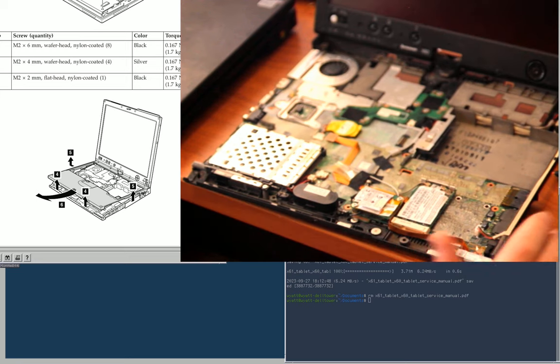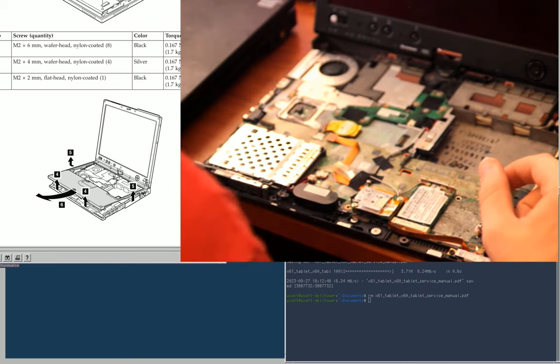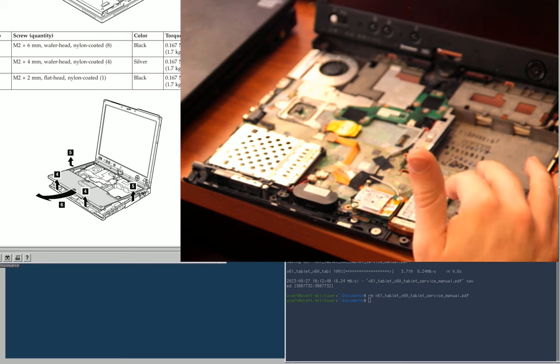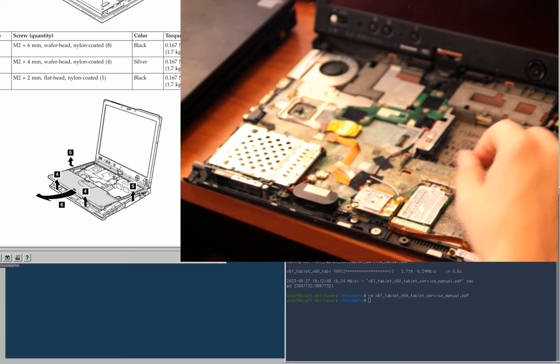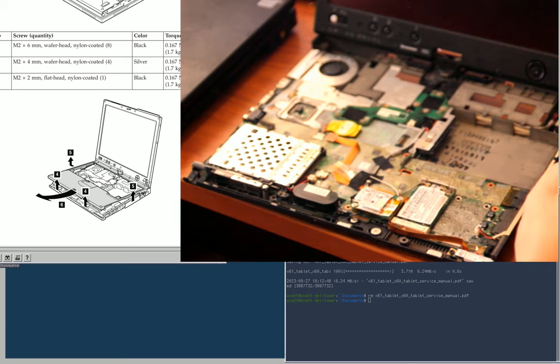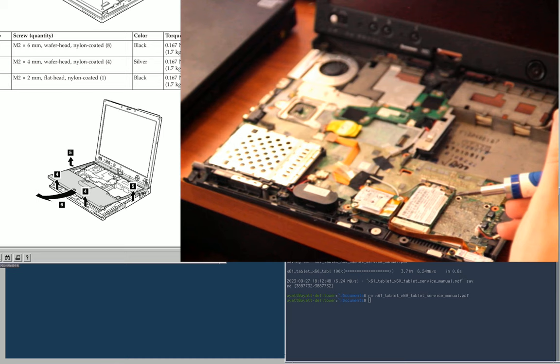Okay, so just remembered another thing. The wireless card in the X61 is screwed down here, and these things get really hot in the X61. Unfortunately, it seems like the screws like to get fixed in place. So if I ever want to replace the wireless card in the X61, I'm going to have to drill it out. Really wish I didn't have to do that, because it doesn't have release tabs like this one does. But oh well. I would like to replace it with an Atheros card eventually, like I did in the X200 series. But we'll see if it ever comes to it.